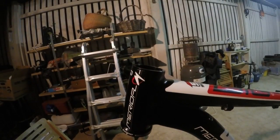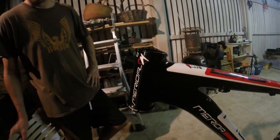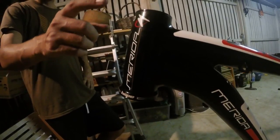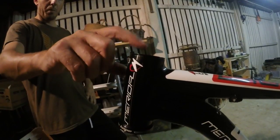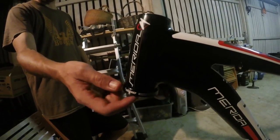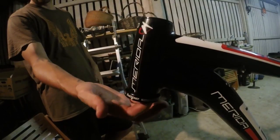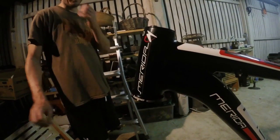So after a lot of stuffing around, finally got these headset cups in. As you can see, this is a straight steerer head tube. We've got a 44mm diameter head tube, so I've used the Hope number 2 top cup and the Hope — I think it's the H, could be wrong on that — but anyway, that's going to basically have the steerer bearing sitting inside there, so it's not actually sitting in the head tube but just on the outside, and that'll let us use a tapered steerer.